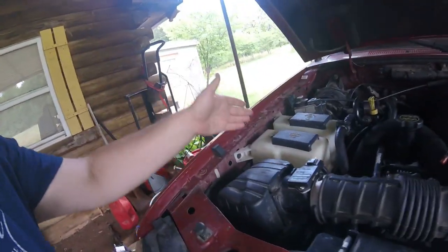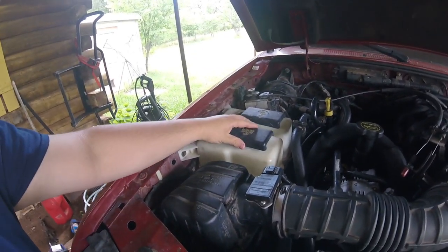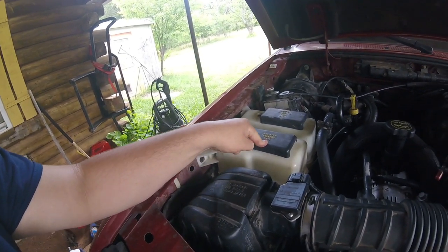And then we watched the rest of the truck, or the back half of the truck, and now it's back over here. Now, I did take it for a little bit of a drive, and got about 2 miles down the road and was on my way back and started to see it overheat. I was like, okay, turn it off. So when I turned the truck off, I came out of the truck, opened up the hood, and found the overflow tank, the expansion tank, completely full, and there's a little relief hole right here. And it was squirting out. So the whole overflow tank was filled.